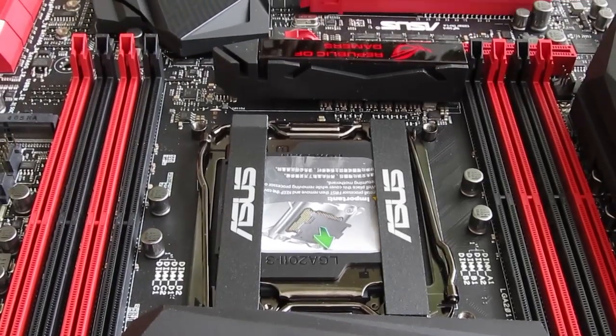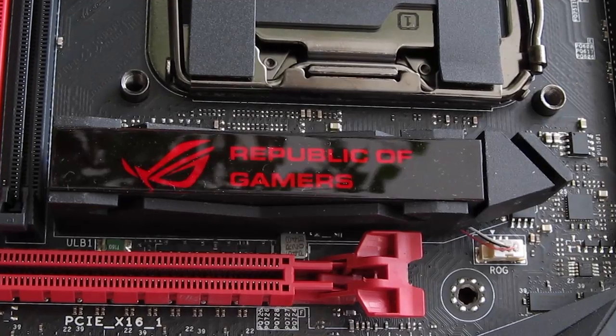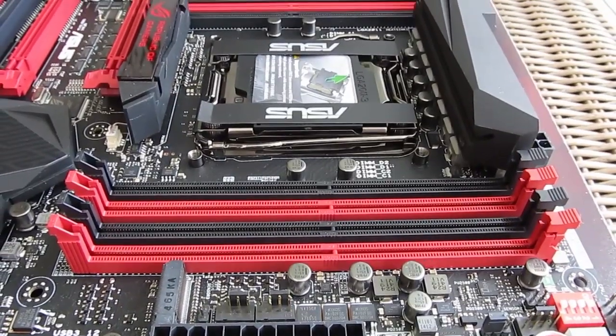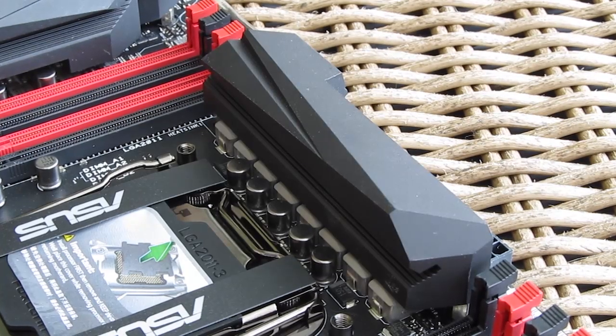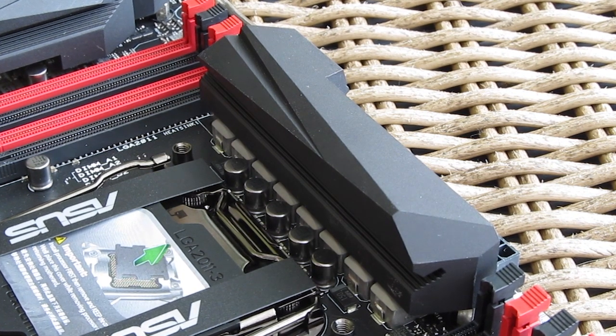Also, as seen on the latest Z97 and Z87 ROG motherboards, now we have a ROG logo glowing just beneath the CPU socket. Speaking of the socket, it's surrounded by 8 quad-channel DDR4 DIMM slots, supporting up to 3300 MHz RAM, and above it, you can see the components that make the Extreme Digi+ 4 power design, like the microfine alloy chokes, 10K black metallic capacitors, and so on.